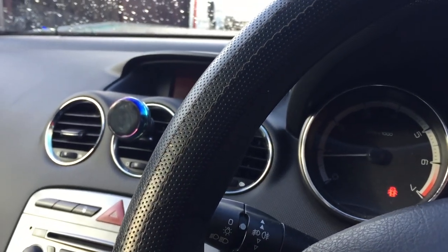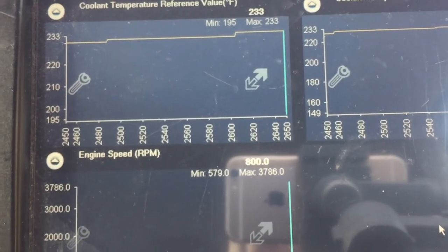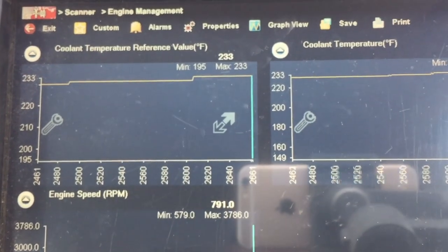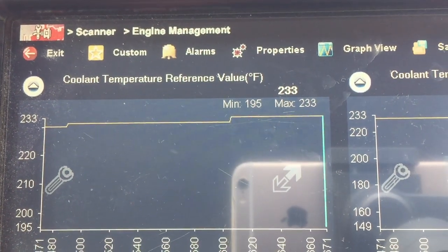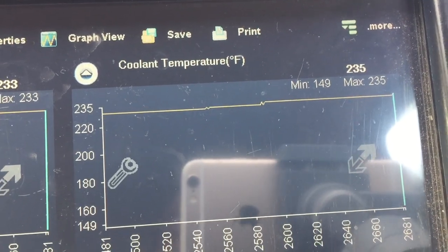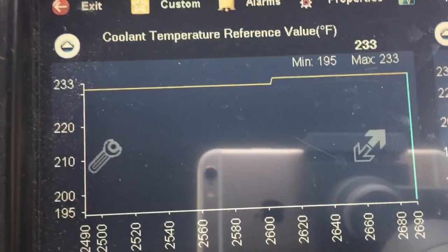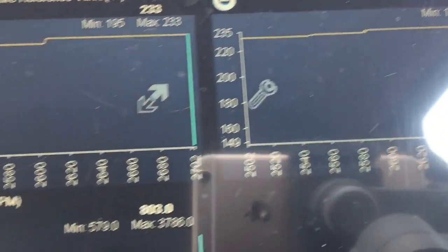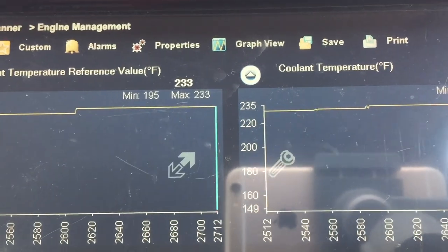Oh dear, the task goes on. Well, sometimes you've got to slow down to speed up, as they say. So I drew up - I went back to the Verus to see what I could graph, because that's quite good at graphing. And as you can see there, I found this pin - it says coolant temperature reference value, then coolant temperature value. So we're currently sitting at 235 degrees, yet the car's looking for 233. I've been just idling with this thing, and when it does go over the threshold, the fan is coming on.